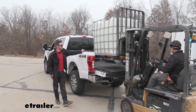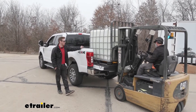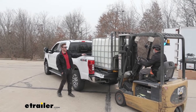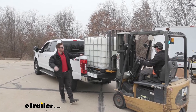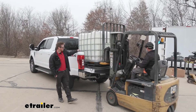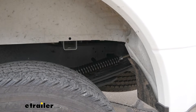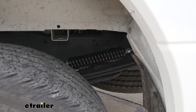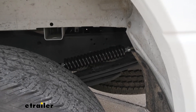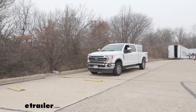I called my buddy Joe and he's going to put some weight in the back of the truck - about 1,500 pounds, give or take - so it's quite the load. Wow, I can already see the spring working, so it's going to be very interesting on our test course. Thanks Joe, I really appreciate it. Right as he lowers it down - I don't know if you can see it on camera - but that spring is definitely working. Less load on my leaf springs, that's what we're really going for here.